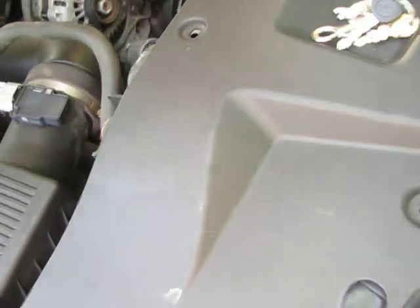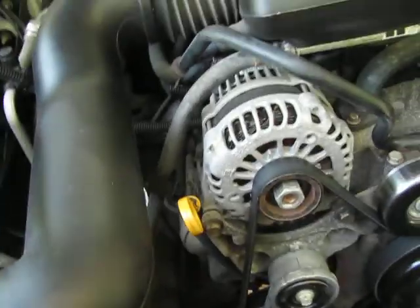So that concludes this video. If you wanted to replace the alternator based on the results of this test, I would say you stand at least a 50% chance of having a charging system afterwards — maybe closer to 90%. But there is a chance it could be something else. It could be a loose wire on the alternator, a connector come loose, a fusible link, something broken, or a relay. There may be a video on YouTube covering how to test the alternator itself — you might want to look into that before tearing into this.